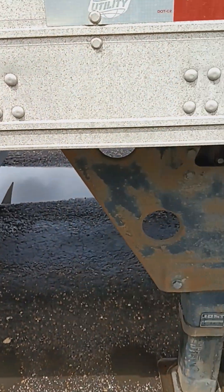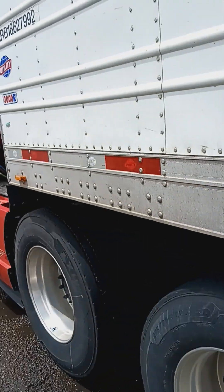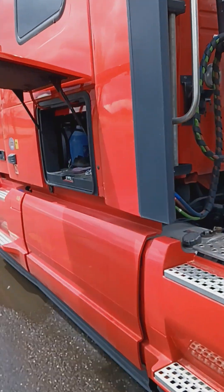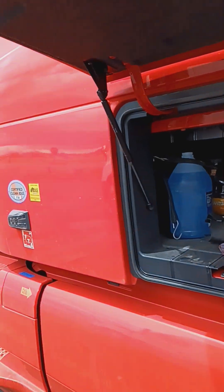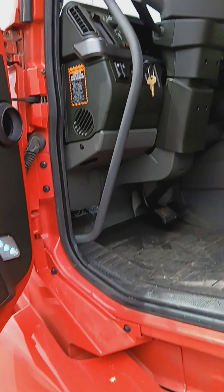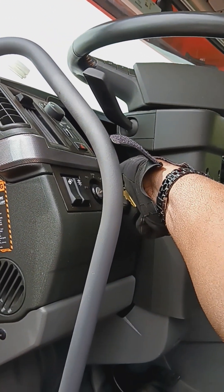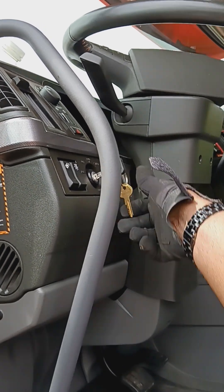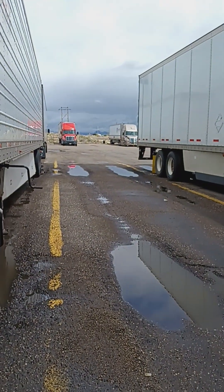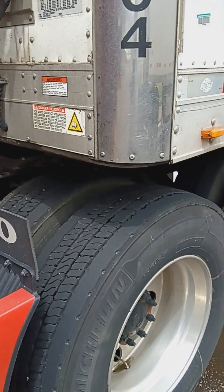What I'm going to do is start my truck so the air can raise the truck, and then I'll extend the landing gear a little bit more. That way it'd be easier for me to get out from underneath the trailer, and easier for him when he hooks up to it. As you guys can see right now, the airbag is inflating, raising the tractor.